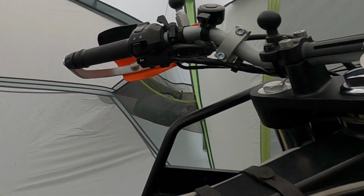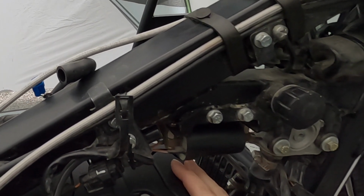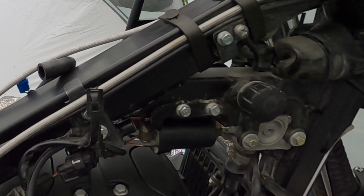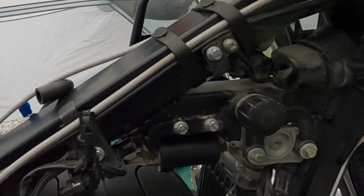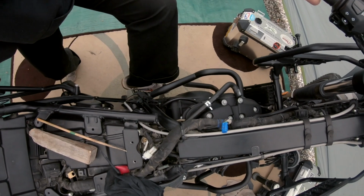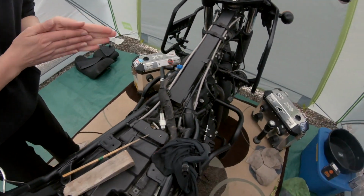Basically what we want to do is get into these two compartments here to check our valves to see if the gap is as recommended for our intake and outtake or exhaust. So we have to find top dead center. I think it's a 5th, okay.